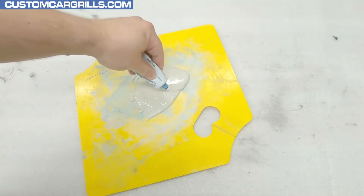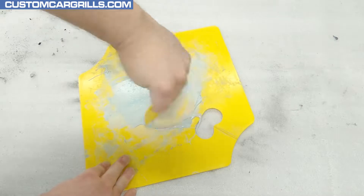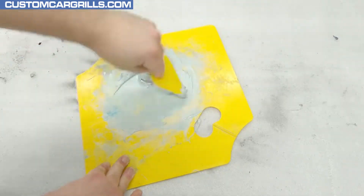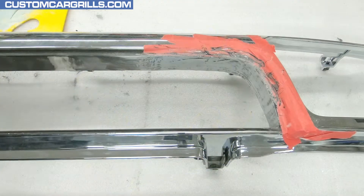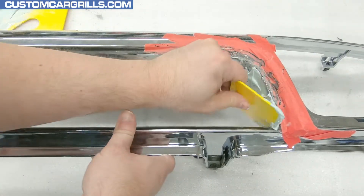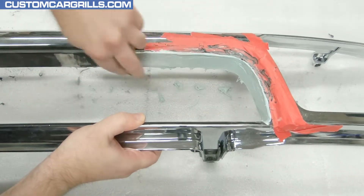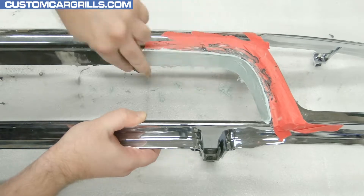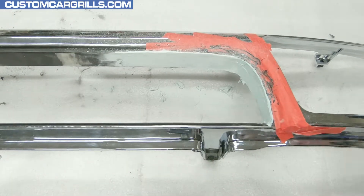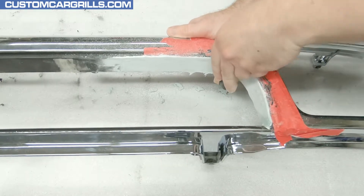And now it's Bondo time. I'll get a small amount out, add some hardener, and then start mixing it up. The edges should be fairly well defined and sanded smooth, so this won't be a thick coat. It's just a matter of spreading the Bondo on — a simple plastic spreader should get the job done easily. After waiting a while for it to cure, I'll get to sanding. Starting with light sanding and a 180 grit paper, I'll refine this down further with some 280 to 320 grit. As a finishing touch, I'll hit it up with some 400 and 600 grit.